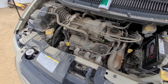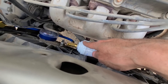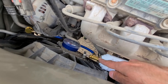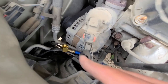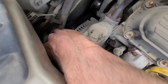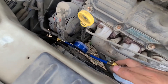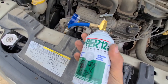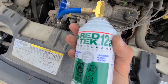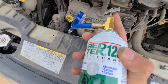When you are changing the cans, do not just unscrew the empty can directly, because you will open the system and all the refrigerant from the van will leak out. What you have to do first is disconnect the low pressure charging port sleeve, and then unscrew the can. Once that is done, you can safely unscrew the can and repeat the process from the beginning — first screw on the new can, then connect the low pressure charging port, then pierce the can and continue charging.